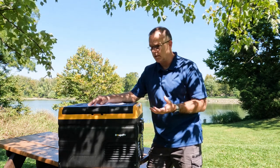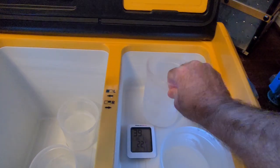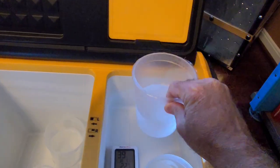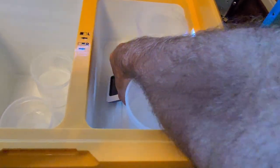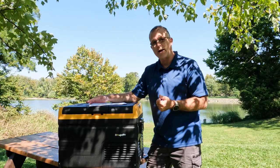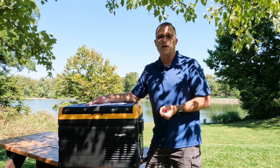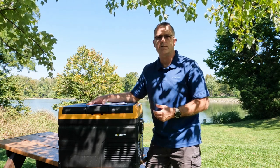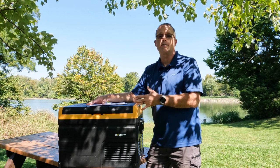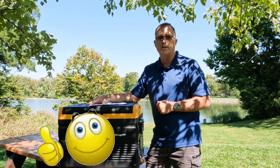I was very interested in understanding how well insulated this thing is. I didn't have high expectations because it's a fairly lightweight refrigerator, but it did surprisingly well. I froze eight cups of water in four two-cup containers, starting at 22.1°F, then shut the power down and monitored every hour. After one hour, the interior had only risen 5.4 degrees. After two hours, only about 12 degrees. And after four hours, the interior had only risen about 19.6 degrees — under 20 degrees net temperature gain — which is very good performance compared to other 12-volt refrigerators I've tested.